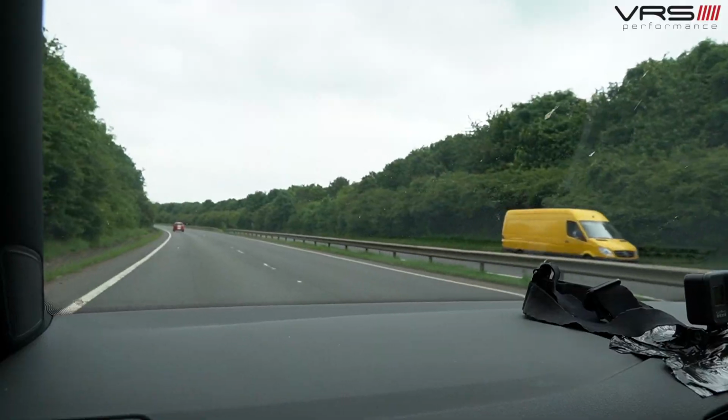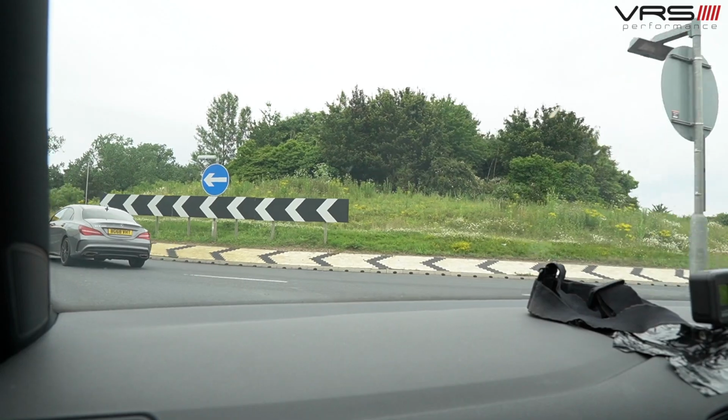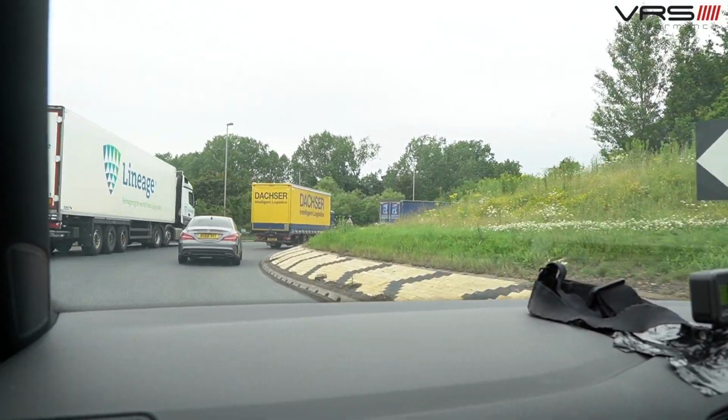Just keeps pulling. It does. That's third gear. It doesn't really spin, does it? No. The intercooler is really the most important part, in my opinion. Because you want to get the air into the engine at the same pressure as it's coming out of the turbo, and the coolest. That's interesting.